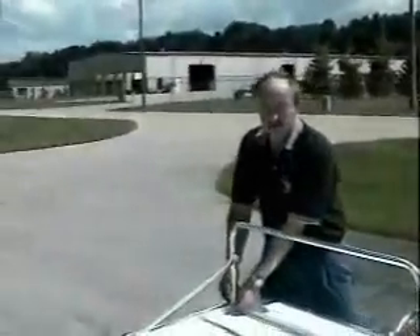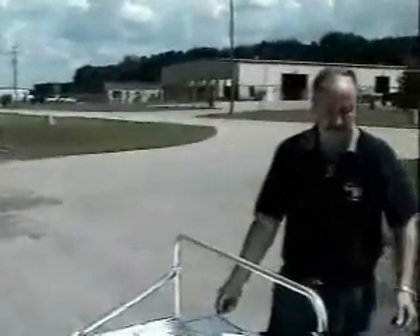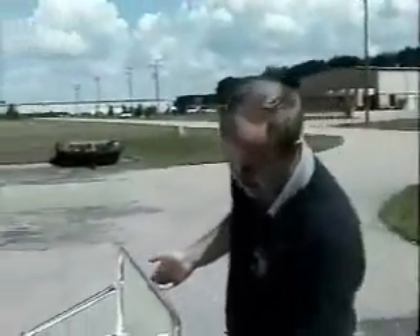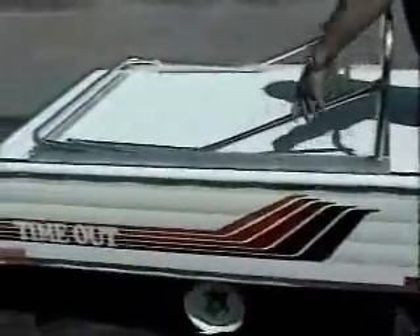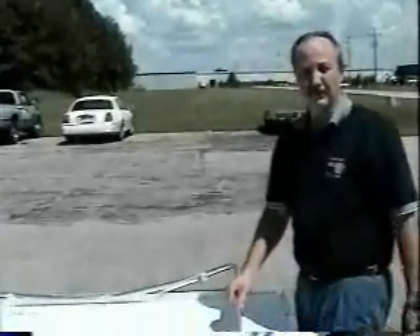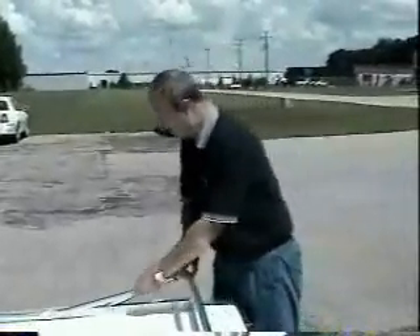A couple of things about care for your trailer: it's a really good idea to keep a nice coat of wax on all the exterior. All the exterior is aluminum and the painted part is baked-on enamel paint — it's just like your car or motorcycle. If you don't keep it waxed, it will tend to break down over time. Especially the screws — they'll tend to rust if you leave it exposed to the weather for long periods of time. Just keep a good coat of wax on it and that will take care of that.